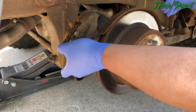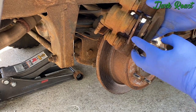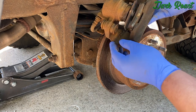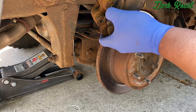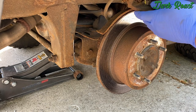Those slide bolts are actually holding the caliper in, so just pop it off. Wow — definitely some uneven wear. This pad still has a lot of life on it, but this one is just gone, down to metal. It's definitely because of the caliper guide pins. We're gonna prop this up so we can remove the rotor, and then we'll replace the pads.